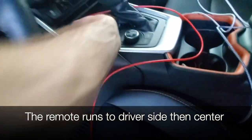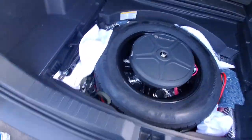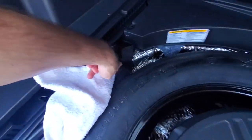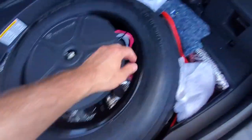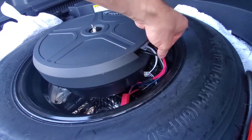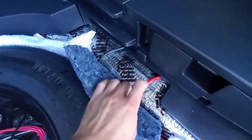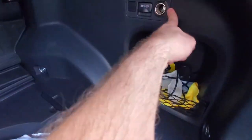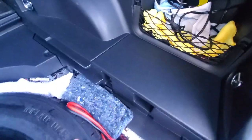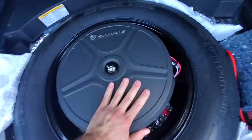The remote control wire runs from the cargo down to the front driver's seat and into the center compartment. Because we can't reinstall the Styrofoam holder for the jacks, I located my jacks to the side with some towels to prevent vibrations. The speaker wires are going under the panels all the way to the front, and the remote wire is going the same way to the driver's side. I have my power and ground where they're not being pinched. If you have a hybrid, the auxiliary battery is located over here and you should be able to connect to it directly.